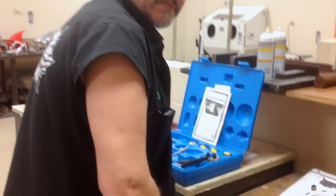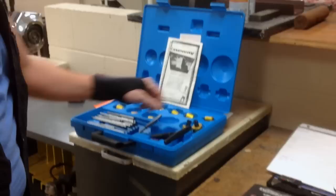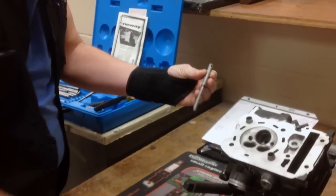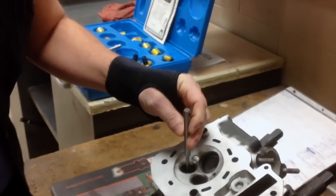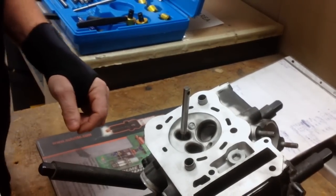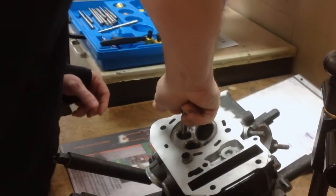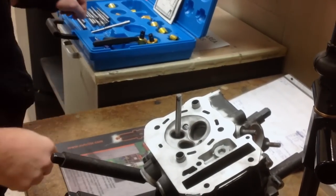We've got some pretty cool new Way tools. We're using multi-angle cutters. He just got done selecting the pilot. The pilot selection needs to be a pilot that'll fit snugly down into the valve guide but does not bottom out in the valve guide. He puts a small handle into that valve guide, gives it a quarter turn while pressing down, and that'll give a sure center and a good seat for that pilot tool.